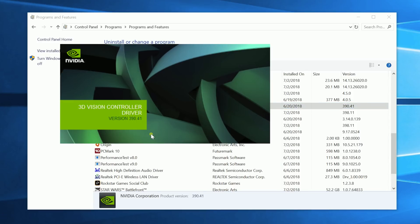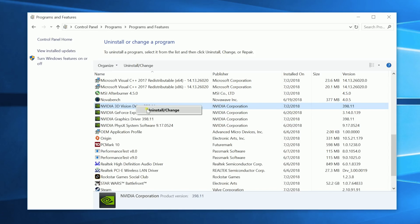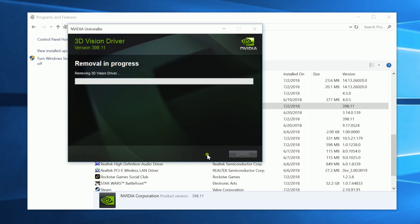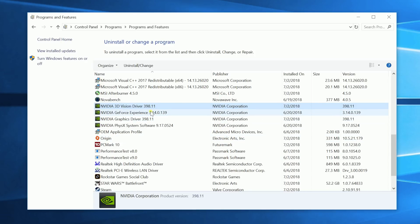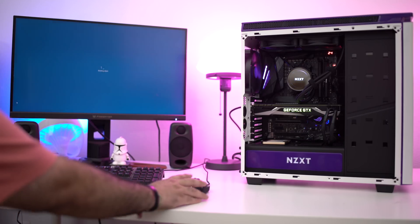If you've already taken those steps — you've made sure that your power supply is good enough and you have the right connections — the very first thing you want to do before you put your new video card in the computer is go in and remove all of the drivers associated with that video card. If you don't do this, sometimes Windows Update will say it needs new drivers for your old video card, and since that card is not there, it just gets confusing. So remove all of the drivers that pertain to your AMD card or your NVIDIA card — get rid of all that stuff. Then shut off your computer.